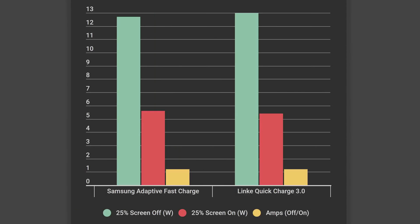Now once we turn off the screen, things start to get interesting. The included Samsung Adaptive Fast Charger and the Linky's Quick Charge 3.0 port top the charts with a maximum of 12.7 and 13 watts respectively. What's interesting is that in both of these scenarios, the phone is pulling around just 1.2 amps — it's actually the voltage that gets boosted all the way to 9.1 volts in order to provide more energy. Both chargers also provide more energy when the battery is almost empty compared to when it's almost full, which falls perfectly in line with Qualcomm's Quick Charge specifications. We even filled up all of the ports on the Linky charging station, and with 5 phones charging at once, it was still able to maintain these numbers on our S8.